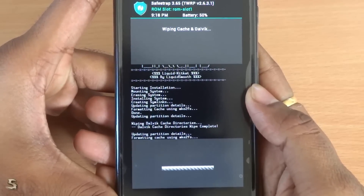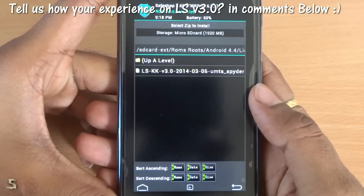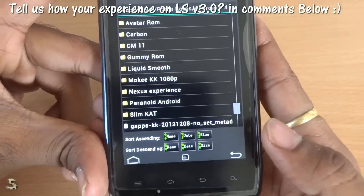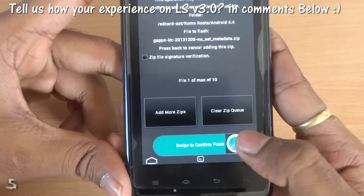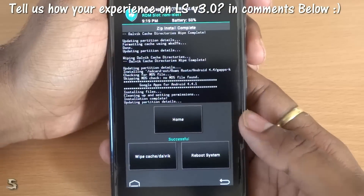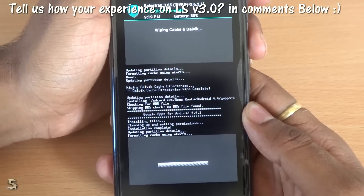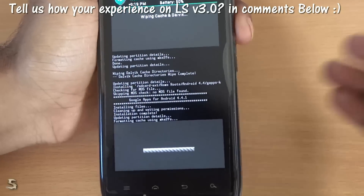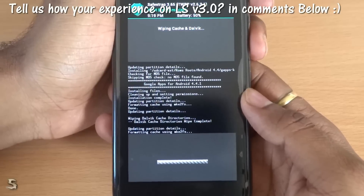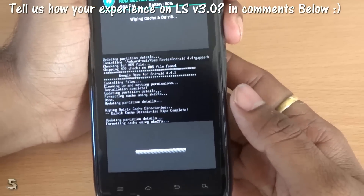After installation of the ROM, we need to install the gapps also. So we will just hit the back button and browse to the gapps — I have kept this in the same directory as well for convenience. We will just select that and confirm to flash. Then we will just hit wipe cache and dalvik — this is the first round. The reason why I do this is we get a clean install of the ROM and we have less bugs. I recommend doing it twice for every zip file that you flash.